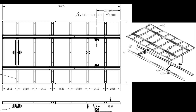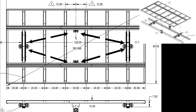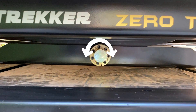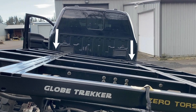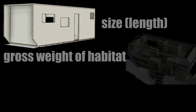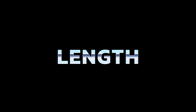Let's start with this given: a 3-point is in a triangle formation, and a 4-point is in a diamond formation. Both formations have a rotational twist along the centerline of the chassis. The side pivots control the subframe movement in relation to the chassis torsional twist. The decision of a 3-point versus a 4-point is defined by the subframe size, weight of the habitat, and also the cantilevering of weights. For ease of explanation, let's start small, then work our way up.